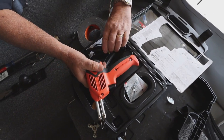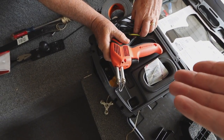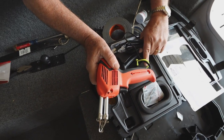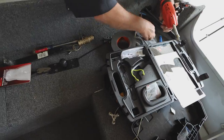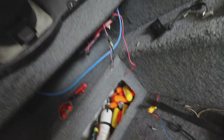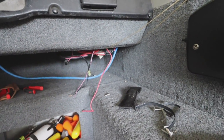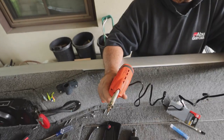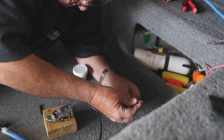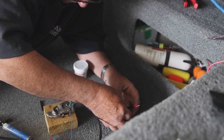Now the options when hooking your wires up together: the best route to go is by soldering. If you know how to do that, that is the preferred method along with some heat shrink tubing on there — you get a way better connection. The other option is to go with some butt connectors. I wouldn't really recommend the butt connectors — they work just fine, but the preferred method is definitely going to be a soldering gun. Something fairly comical: it's only comical when it doesn't happen to you, but be sure and put your heat shrink tubing on before you solder.